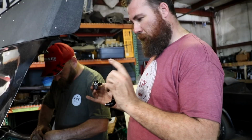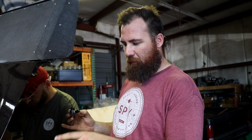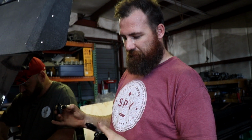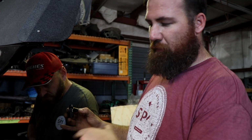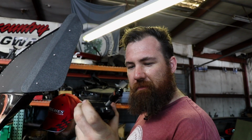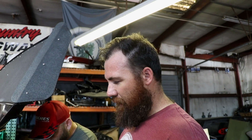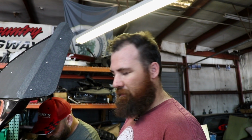So we've got one on the bulkhead fitting that's on the boot floor of the Mustang, and the second one actually goes on the top of the fuel cell. So we've effectively got 2 return lines inside of the boot. One goes straight from the floor to the tank, and the second one runs via the flex fuel sensor. So nice and simple, and a good little way to be able to run a flex fuel sensor on a 1,000+ horsepower car without having to run all the fuel through your sensor.